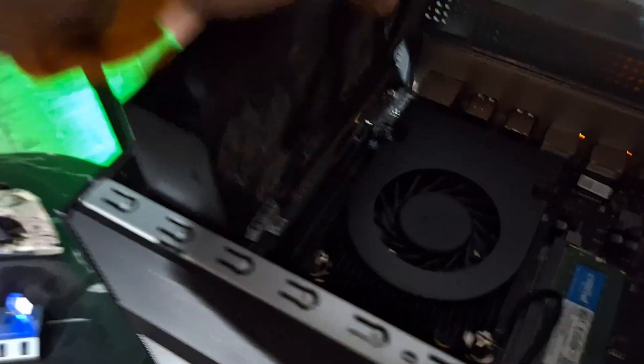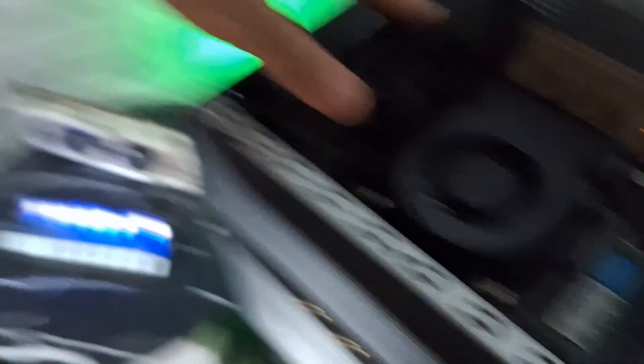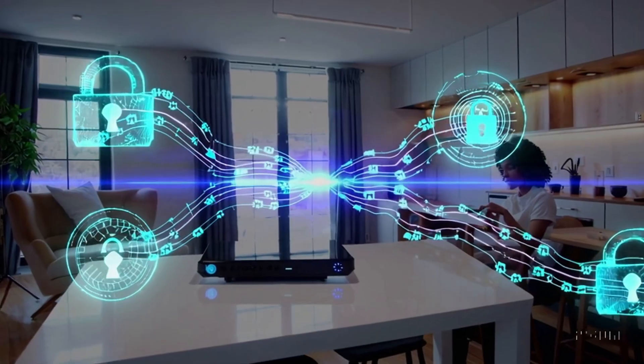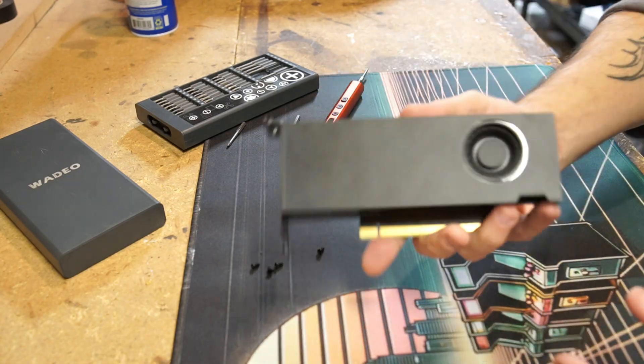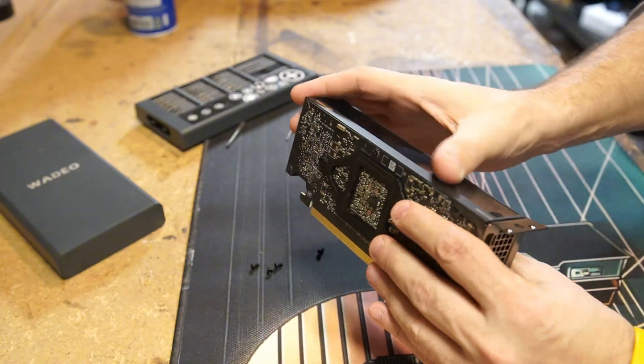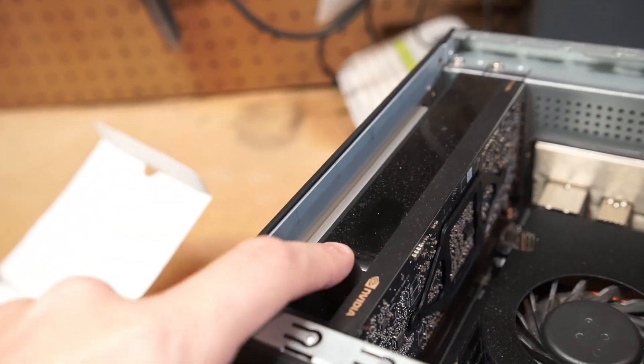I also added a second NVMe SSD and a GPU. I added this GPU previously and released a video about using it for AI inferencing using Open WebUI with different LLMs natively within the LAN for added privacy and security. I'm using the Nvidia RTX A2000 — not the newer Ada version that comes with the creator pack, but still a very capable GPU for accelerated rendering and AI workloads. The one I got from eBay used didn't include the low-profile bracket, so I'm adding that now for stability on the AI accelerator card.